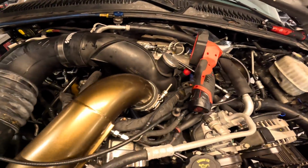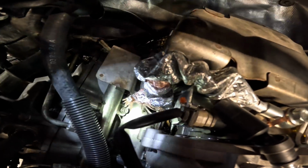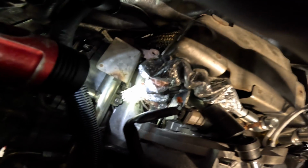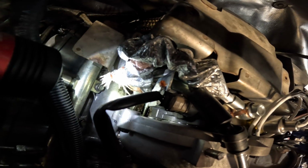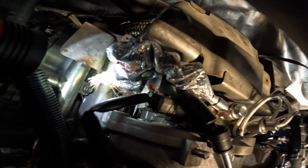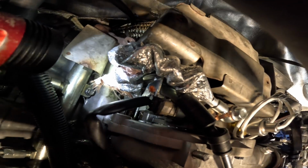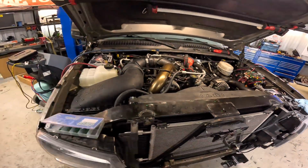Oh, I don't know if I can get in there to get this drain line out, or this oil feed line out of there. Yeah, it runs all the way down. And the problem is the turbo drain line, the one that's leaking is the feed line. The drain line is in the way of the bolt, so I can't even sneak it out. I'm gonna have to take the turbo off. All right, my work is never done.